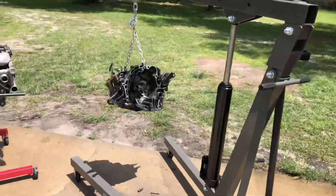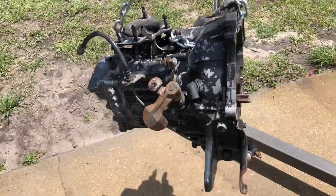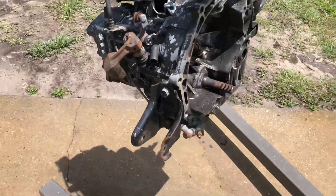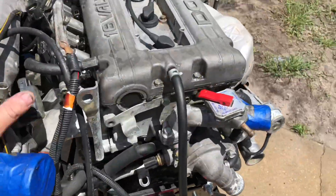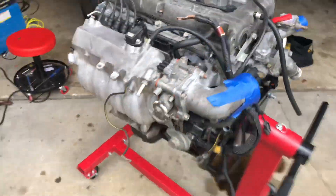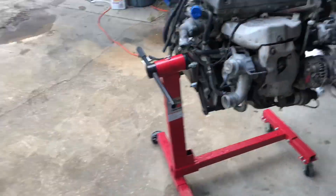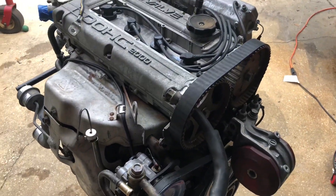I don't really care about the transmission yet, but eventually I'm going to tear this down to see if the center diff is really blown. Feels like it — you could hear something in there. Sometimes they bind up together, sometimes they just totally spin freely. So I'll tear it down another time, but this I'm going to tear down and get it nice down to a short block. Today I'm just going to take off the intake, exhaust, and turbo, drain the oil, take off the head — maybe we'll see. No point in taking everything off yet.